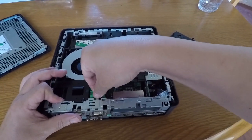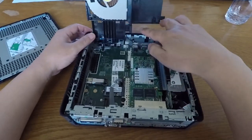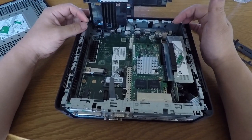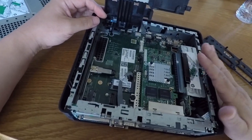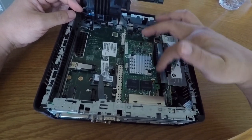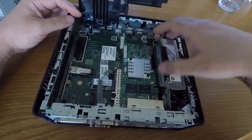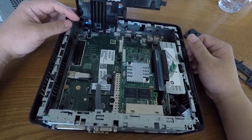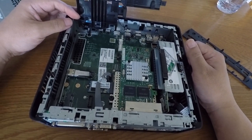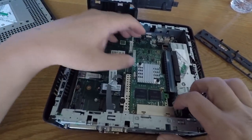Look for anything green, push down and pull back, and the fan assembly just folds open — it's connected through a cable. Here is the PCIe slot. It's a physical x16 slot, so it's very wide and you can fit a long card in here, but it's only electrically four lanes. Anything requiring more than four lanes will be limited in terms of electrical connectivity.